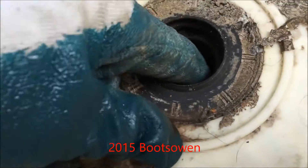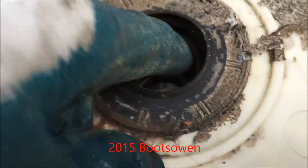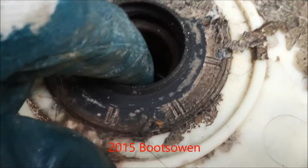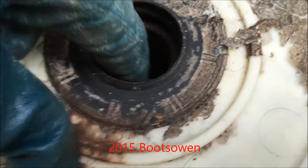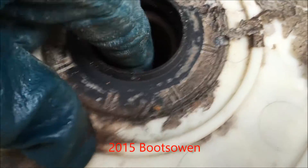Inside of the tub, you can hear that noise, and that free play is in the washing machine bearing — the inner bearing, the one closest to the drum. So it's got about a millimetre of play.